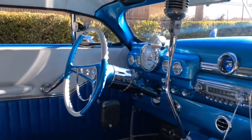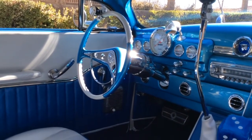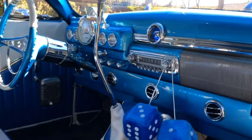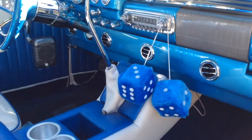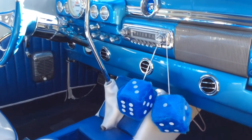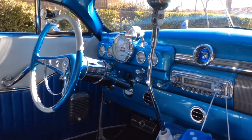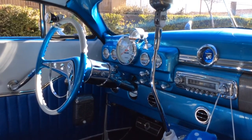My wife got me a nice little gift for the shifter — that's a microphone shift knob. The steering wheel is a '60s Impala steering wheel, pretty traditional for these cars. I painted it two-tone to match the car. The big deal here — if you're gonna build a full-on Mercury, you have to have a '49 dash. They made these cars 1949 to 1951; the 1949 dash is one-year only, super hard to find, very expensive, but worth it in the end. We added a lower valance across the bottom — handmade — to house the AC and heat vents and hide the AC and heat units. There's also an original radio in it. That piece on the dash that looks like glass was an accessory in the '50s so you could see street lights when at a stoplight, because you cannot see them when you're in this car.